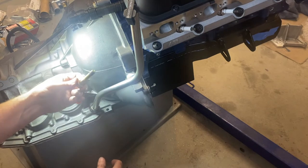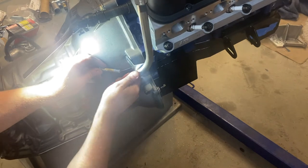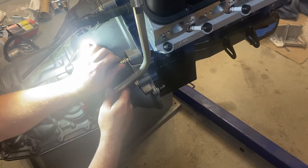I've got all the other bolts torqued down, but I'm not going to torque this particular one down simply because it's possible I might have to move or bend the dipstick tube.